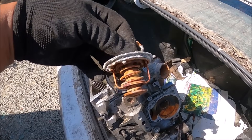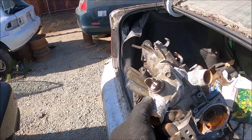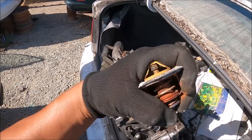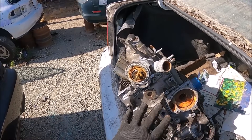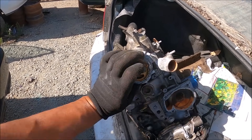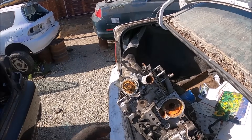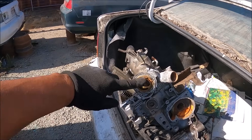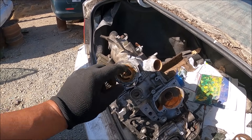Let me show you what my son did on his car to fix his leak. Here's a thermostat right here — that's what it looks like. This goes in like that, and this goes like that. It's spring-loaded with spring tension on it. When the engine temperature reaches around 180 degrees Fahrenheit, this will begin to open up. Until then, there's a coolant bypass hose that just bypasses this section coming into the radiator.